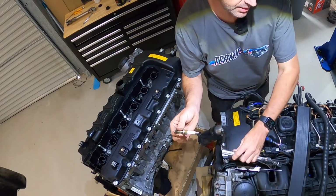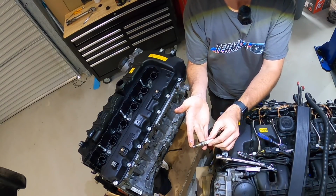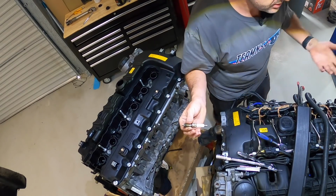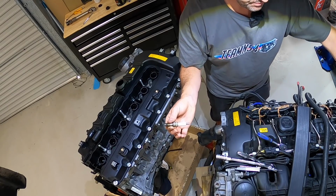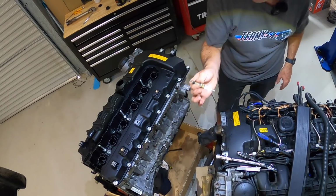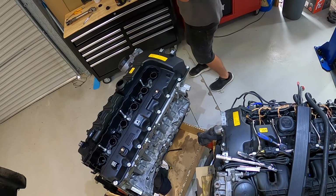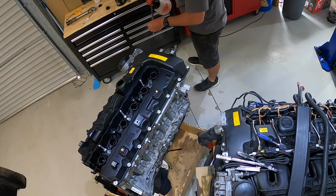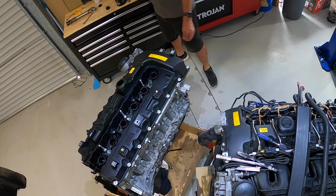This is plug number 6. Now, I had this out when I first had the issue with the engine, and as you can see, it's actually covered in water. That's because for, I don't know, 3 weeks the car's been outside with a broken engine. I haven't had the weather shield or weather tray on the back. So water has gotten down into the spark plug hole, which is a bit annoying, but we'll give it a brake clean, a blow off, and she'll be good.